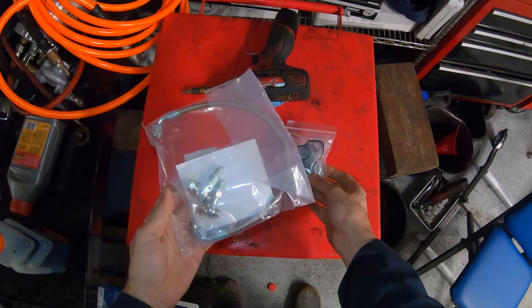This is the exhaust manifold, which goes into the turbo, and that goes into the downpipe. We're going to leave the exhaust manifold in place and the turbo will stay in place, but we do need to remove the downpipe. The turbo feed line goes around the back side of the turbo and then goes in behind. There are two heat shields — a front and a back. The turbo feed line and one of the bolts for the filter housing gasket are behind the rear heat shield. I'm going to disconnect the turbo feed line from the top of the turbo — it has a miniature heat shield, which you want to save. It has a fitting with a rubber O-ring that degrades over time.